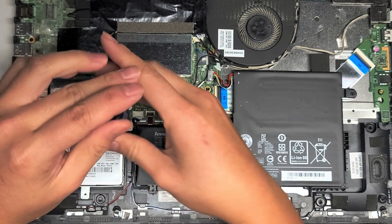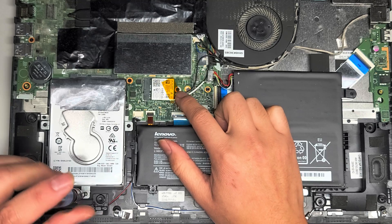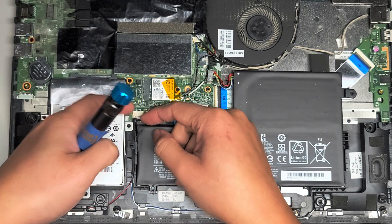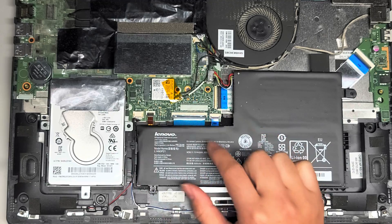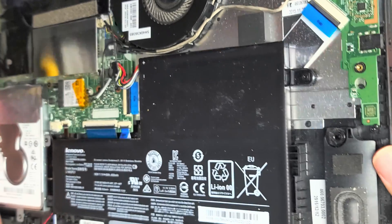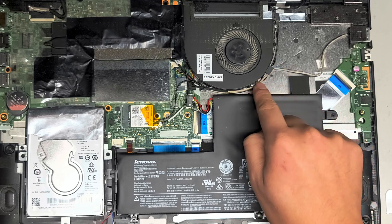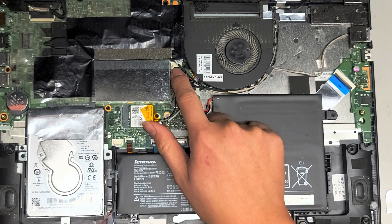I forgot to mention — the wireless card is here. The antennas, just like every other model, are easy to remove: one screw, it pops up like the RAM and you can pull it out. The speaker connectors here — to remove that, you just use your fingernails or a tool and wiggle it to pull it out. There's the keyboard backlight connector with a flip-up latch, then the keyboard connector, trackpad connector, and a connector for the USB board with the audio jack, volume buttons, rotation lock button, and SD card slot. Then you've got the DC jack or charge port cable that runs along here and plugs in right here — you just grab it, wiggle it, and pull it out. The fan connector is right under it.